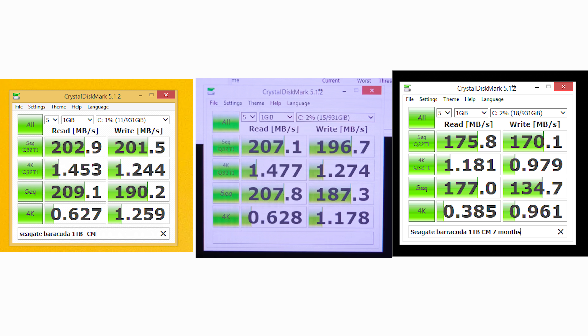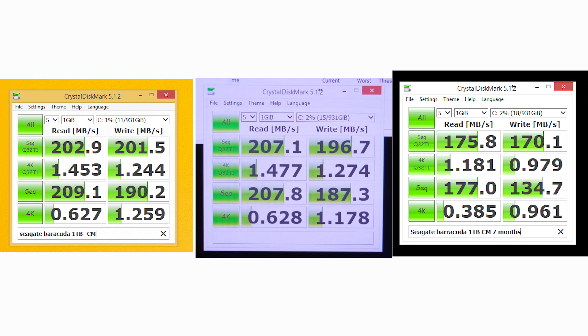Let's take a look at CrystalDiskMark to see how it's held up. Performance actually isn't too bad — we're running 18 gigs filled instead of 11 gigs from the first test. Comparing the current drive to the first test, while there is a difference it isn't the world's biggest one. Comparing pre and post death, there is a drop in performance — from around 200 MB/s on the sequentials down to 177 MB/s. In real data operation it wouldn't be noticeable, but on the synthetic side it has been. I can't tell whether this dip is a result of the death and resurrection of the drive, but there is a loss in performance.